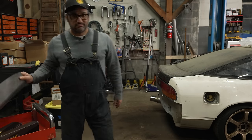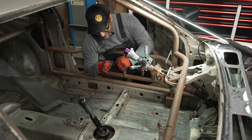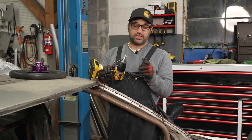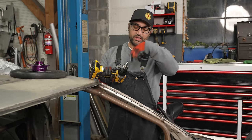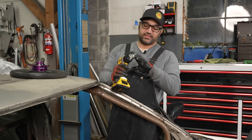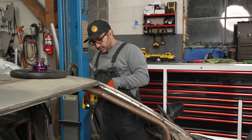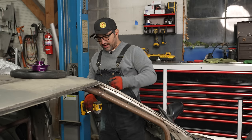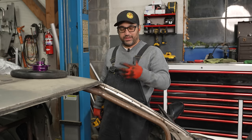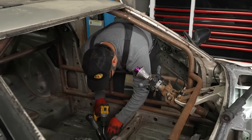This is all just spot welded in. I'm going to get a spot welding broach bit and start knocking those out and pull this rail off. I have a spot weld cutter here — this is a flat cutter, it's going to center itself in the weld and just grind straight through. I like these a little bit better because they do cut a little more if it's a big wide wonky one. Just aim for the center, knock them out, and pry it — wiggle and see where it is.